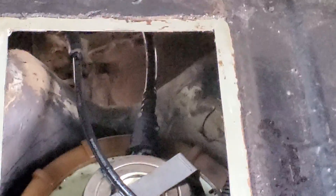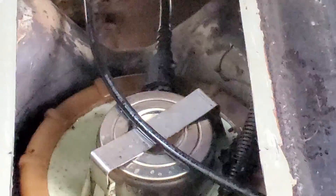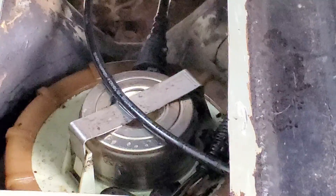I shut it off immediately and grabbed the camera so we could document this. Found the problem — fuel pressure regulator — and with our new access port, no more dropping the tank. Give us a thumbs up or leave your comments in the comment section below. I'm Irish, USMC vet. Godspeed — it's another Jeep thoughts.